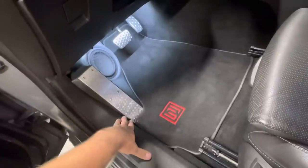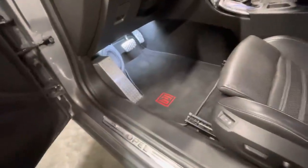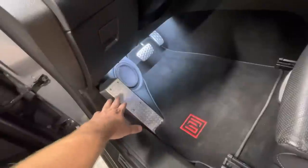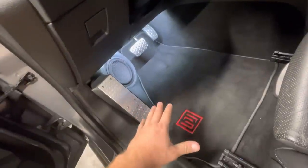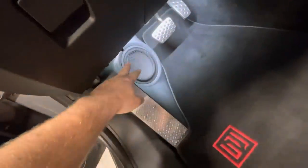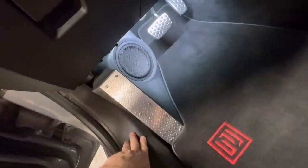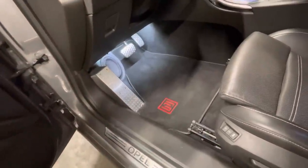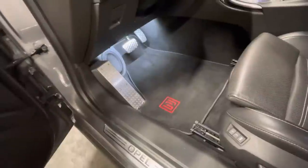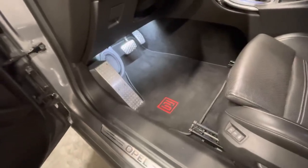Since it's an automatic, you don't need your left leg anyway, so the footrest definitely helps. The whole enclosure was fiberglassed and built up from several layers of chopped mat with a plywood baffle on top. There are two bolts underneath that go into rivnuts fitted into the steel work of the car. It sits so firmly that even without the bolts it would stay, but with them it's completely secure — giving a perfect non-resonant environment with literally zero rattle.